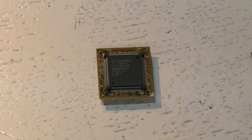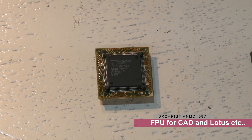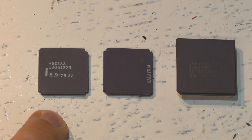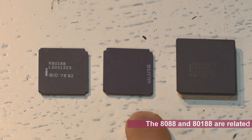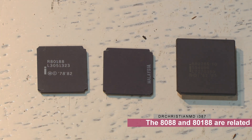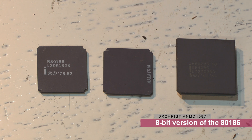AMD was a major player in the 486-compatible chip market with its own line of Intel-compatible 486 chips. The 486 DX chips are the ones to look for — you don't really want the SX chips because you'll need a math coprocessor for them. These earlier chips here are 286s, this one is a 188, and this chip was manufactured right up until 2007 — about 24 years of production, used in embedded systems.